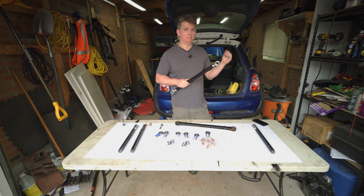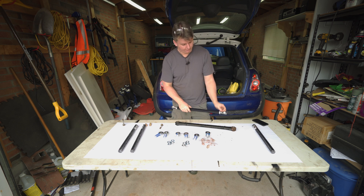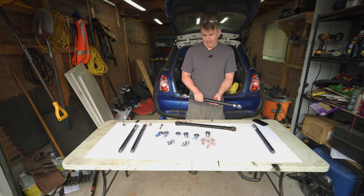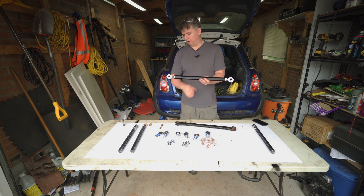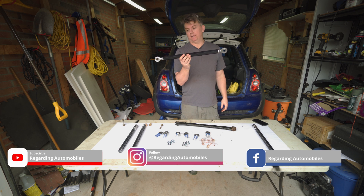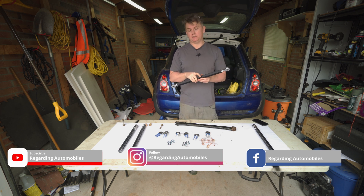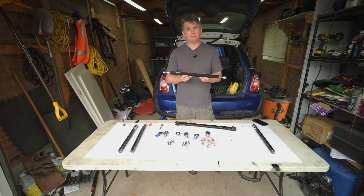They're cheaper, they're stronger — what's not to like? I'm doing it for my Mini Cooper S, but you can do this for any car. Just make sure you have enough thread left in the bar after attaching everything so they won't come out — measure your own car and you can build your own. I'll build the other four, and the next video will be me putting the rear end back together with these new control arms. Like and subscribe, check out the other videos on the channel, and stay tuned for the subframe install video coming in the next couple of weeks. Thanks for watching — see you next time.